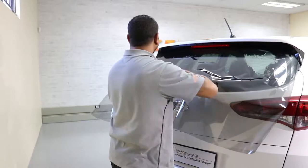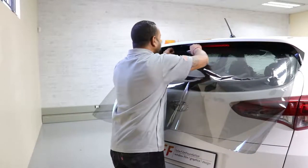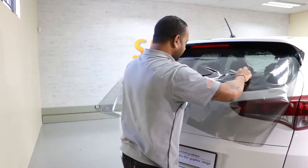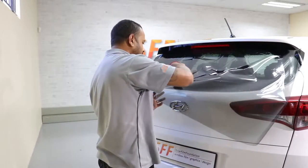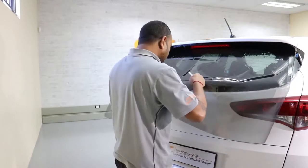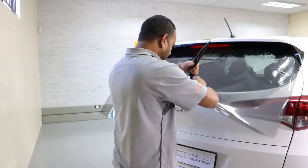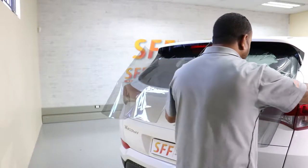Once we position this, we need to straighten the top. When trimming, please use single-edged razor blades as they are safe to use on the back glass. Make sure that you trim all excess so that if the ends get burst when moving, you have already trimmed everything before it starts.